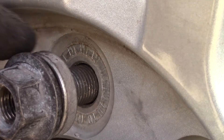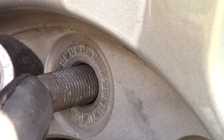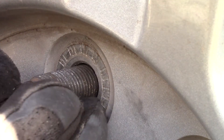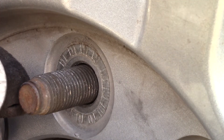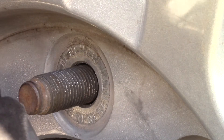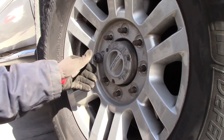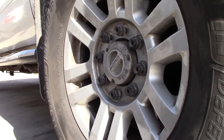Do you see the marks on the wheel from the washer? These are designed to be stationary against the wheel and not spin against the wheel — that's why you need that oil between the washer and the nut. Where's my 21? Oh, it's on the torque handle.